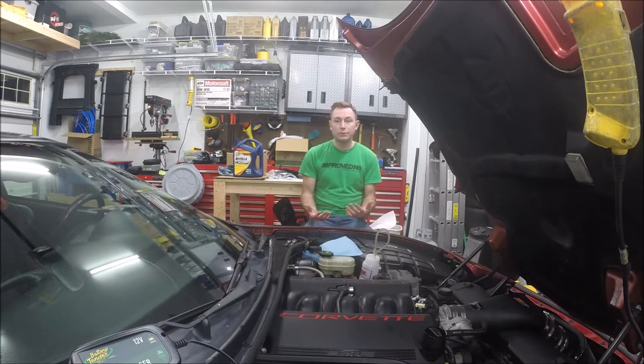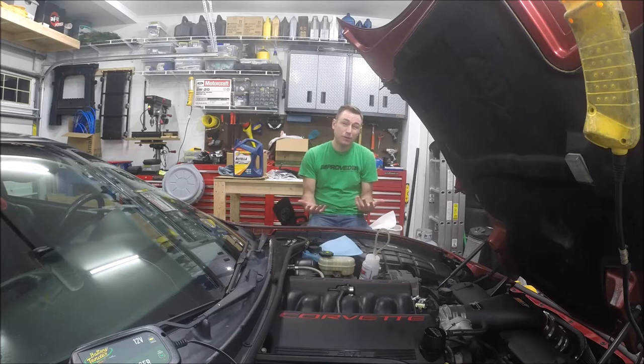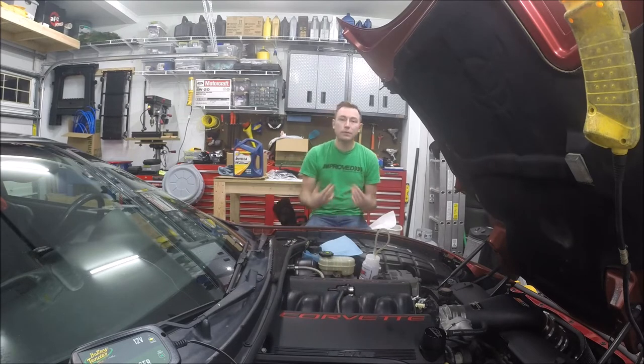Now if you've watched my videos for a while, you may remember that one of my early videos I showed you how to change the clutch fluid using what's simply called the ranger method — essentially sucking out the old fluid, refilling it, pumping the pedal a million times, and repeating the process trying to move fluid from the reservoir down into the slave cylinder and get some of the old gunk back out. It's a very tedious process and it really doesn't work that well, but it's kind of the only option you have in the stock setup.